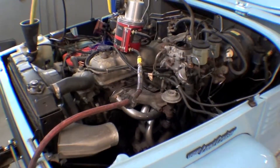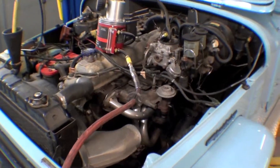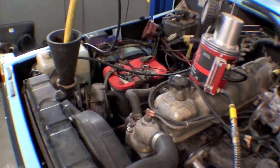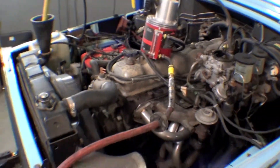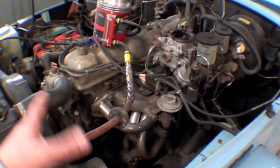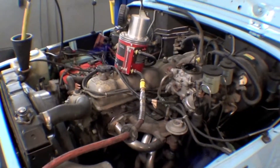We're going to start the truck up and do what's called the chemical test. A chemical test is a way of taking a little bit of fluid or gas out of the radiator to see if we have exhaust gas being injected into the cylinders and down through into the cooling area, somewhere in there.